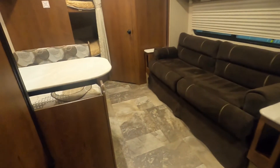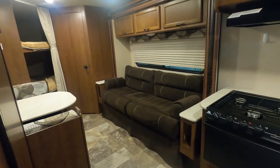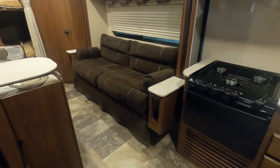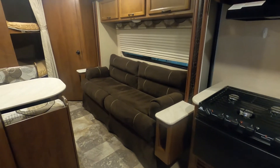There's your smoke alarm — sorry I didn't mention that earlier. So first and foremost, close this door. Shut off all your lighting. What I like to do is come back over, shut off the main lighting here, then I can see any individual lighting I need to shut off. Once everything's off, turn the main back on. Make sure nothing is in the way of the slide — your sofa's back in sofa position, your bathroom door is closed — then slide it in. See the importance of having nothing in the way. If you hear a little grinding noise, don't worry — it's not actually grinding; it's the slide keeping itself from going in too far. Then shut that off and head out of the unit.